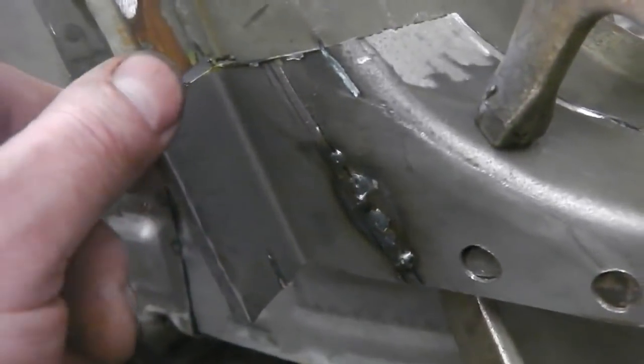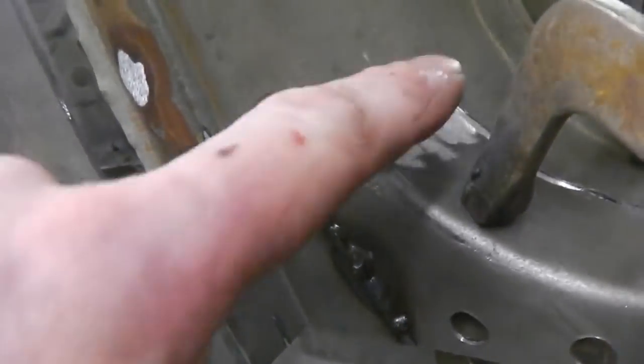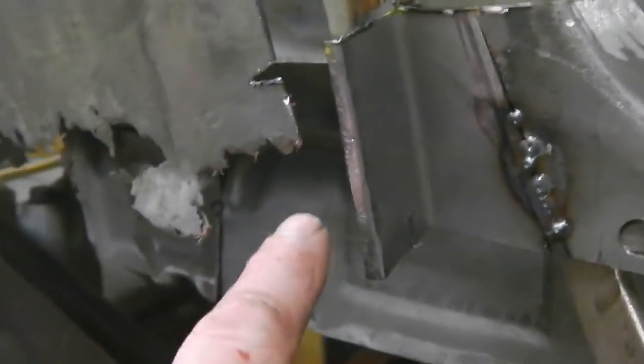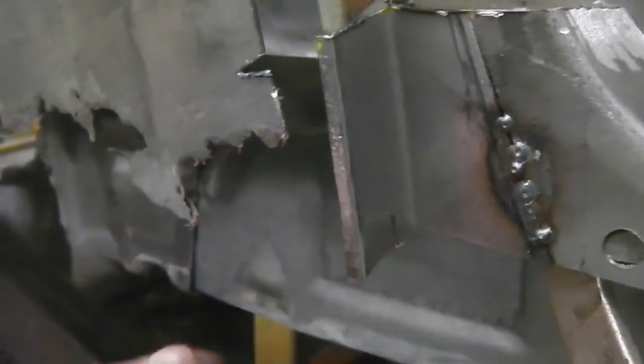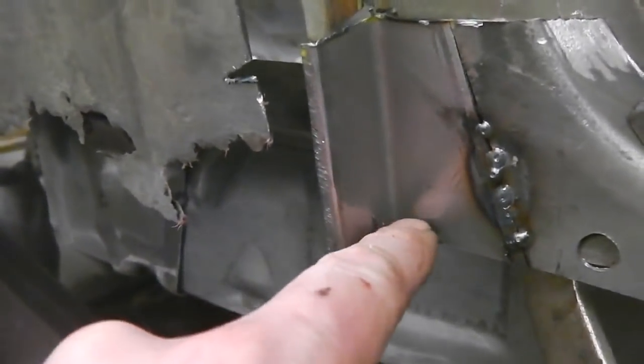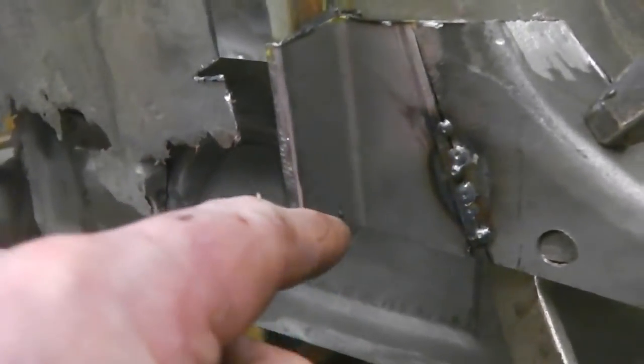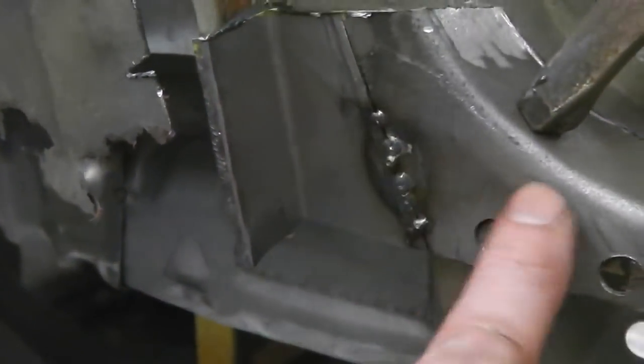Oops, there goes the jobbies connecting to the magnets again. Weld, cut out, weld, then trim to the spec that you need. We're going to have to measure it, but this will be oversize. We could leave that until we get the wing fitted and cut exactly how we need it. The main thing is to get this shape.